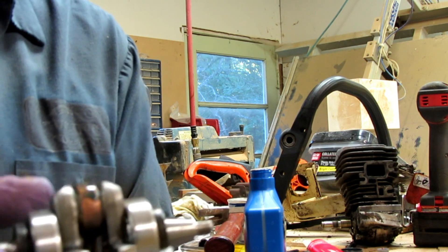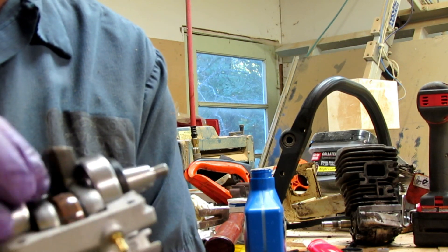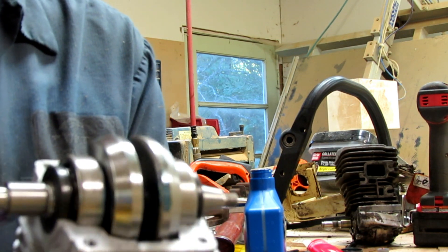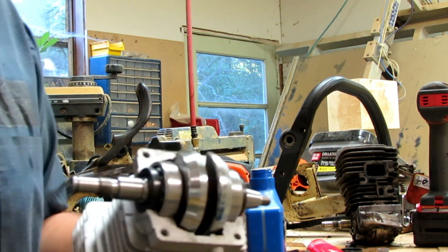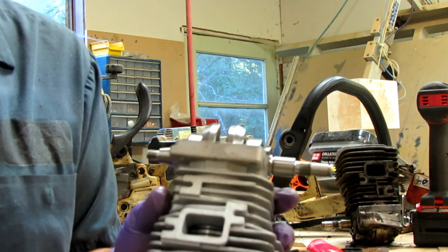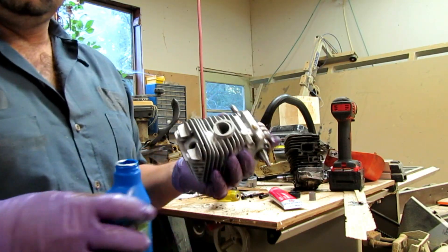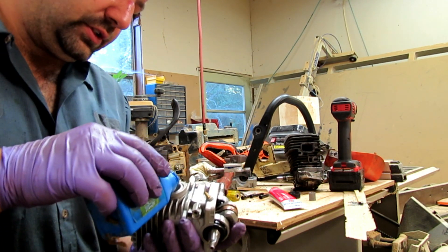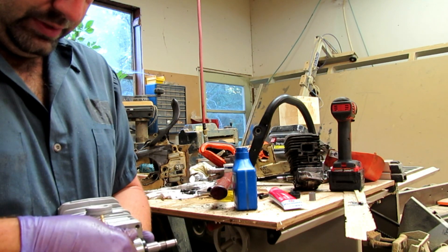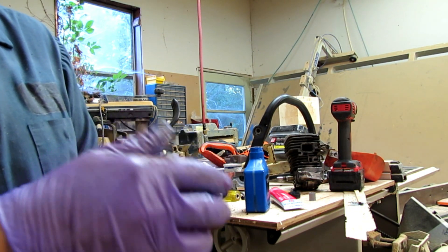At this point I've got some in there, and I can go ahead and rotate the crank around and get the piston moving around a little bit, being careful not to damage these seals out here on the outside. Here's the exhaust port — I'm just going to put a little dab down inside of there. Over here on the intake side I'm going to put a little bit in there too, just a drop, and kind of let that work around in there. I've got it properly lubricated — it's got plenty of oil in it.